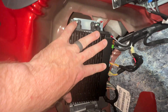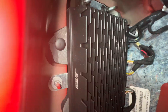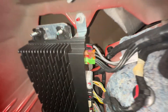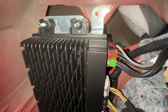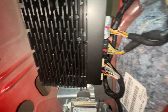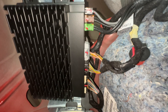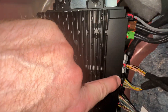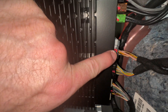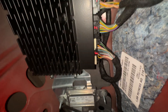What you're looking for is this box that looks kind of like an amplifier. It's got these fins on it for cooling. These connectors up here are fiber optic cables that connect to all the different cameras. And then the bottom three plugs are the cables that connect to the CAN bus. You've got the black, the brown, the green fiber optic, and then a gray CAN bus, a black CAN bus, and then kind of a tan CAN bus.